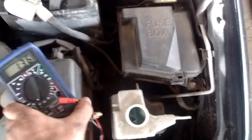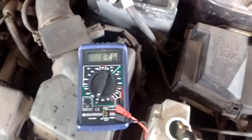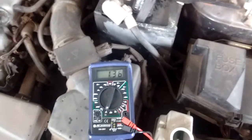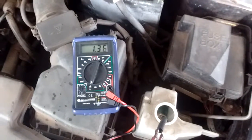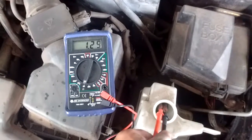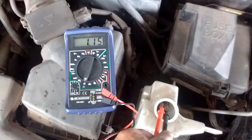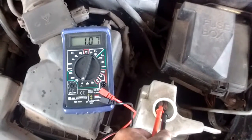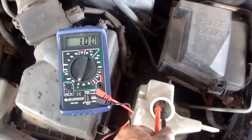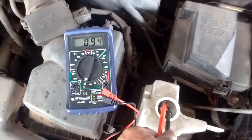So what I'm going to do is take this temperature sensor and dunk it in the warm water, and we're going to see what happens to the resistance. With a thermistor, the resistance changes with temperature. I just dumped it into the hot water and immediately the resistance starts to drop. It should stabilize at some constant value that corresponds to the temperature of the coolant in the bottle.